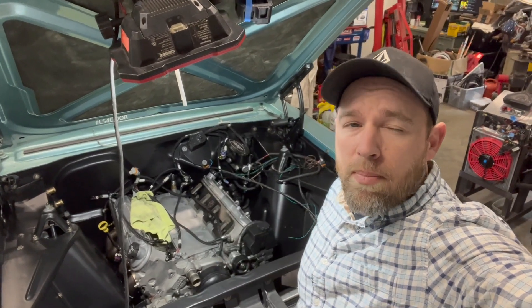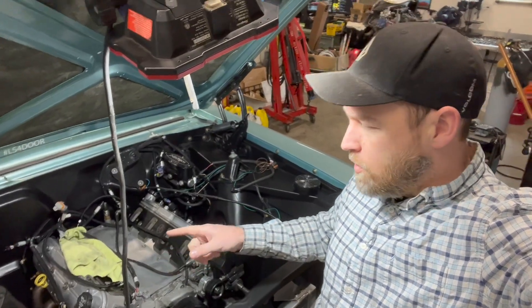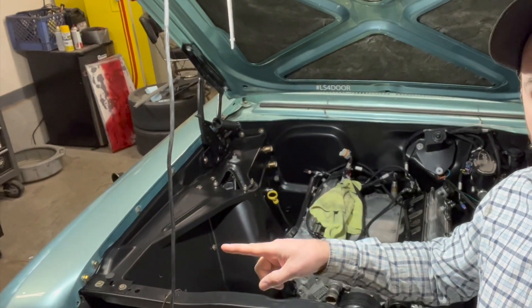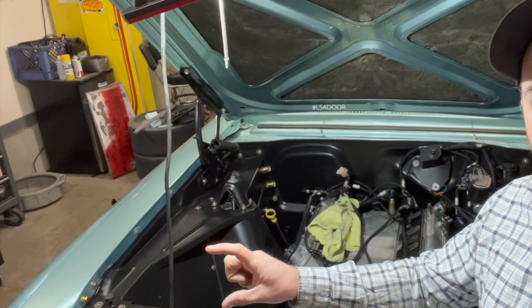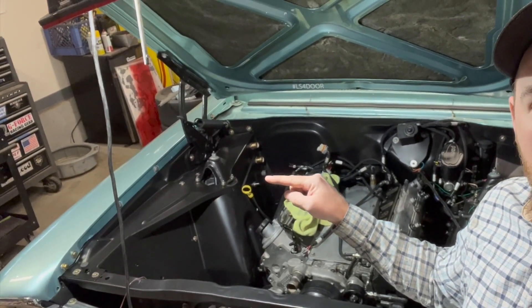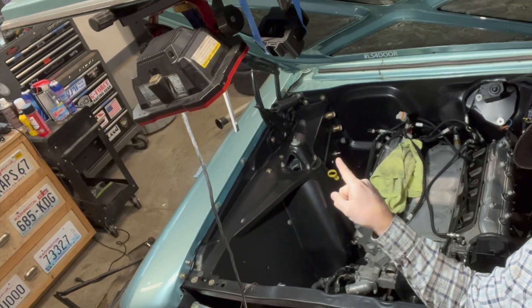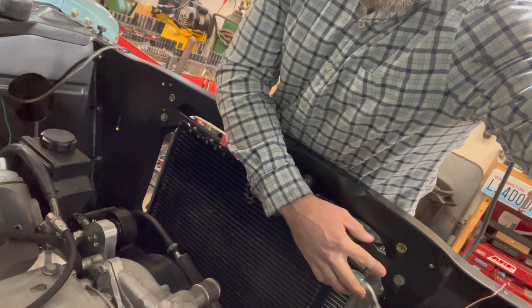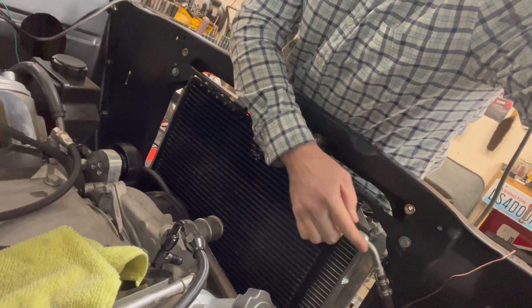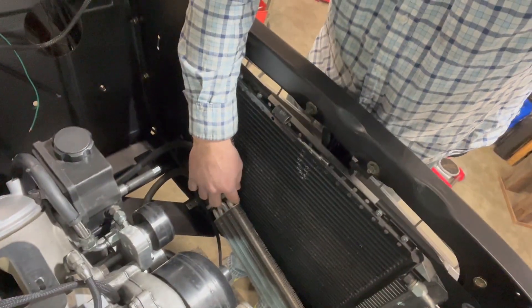It's a new day and we got quite a bit done. We got a lot of the front drive stuff put on, and we have the coils on the passenger side that need to go back on. I was able to drill and set up the overflow — it used to be right there, but I put the catch can and tank there, so that whole space is filled. I moved the overflow to the other side of the shock tower with a bulkhead pass-through. It'll come out of the radiator, through the fender well, and into the catch bottle. The condenser is set up via Vintage Air, and I'm going to put some riv-nuts in instead of nuts and bolts since it's a pain when everything's in. I need to take it out anyway to attach the power steering cooler, so I'll drill the holes a bit bigger and set up the riv-nuts. Today, hopefully the blower goes on and we get the passenger side coils done.